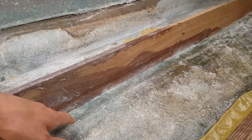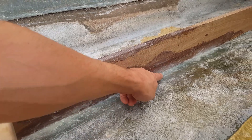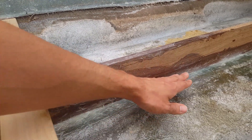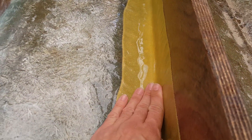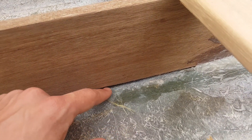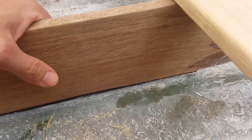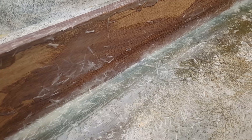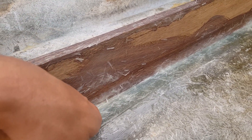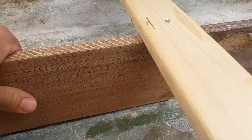I've gotten a few questions about how to apply the peanut butter properly. What you want to look for is any kind of gaps. You'll see how I've applied it to make a smooth edge, and it just gives something for the Kevlar to stick to. Do you need to have peanut butter applied under the stringer? Not necessarily. But as you're applying the peanut butter paste in between these stringers — you'll see here we've got about a quarter-inch gap — the peanut butter will kind of flow in there. The epoxy or polyester resin, whatever you're using, will actually flow in between there naturally as gravity pulls it down. It also depends on how thick you make your peanut butter; if it's really super clumpy, it probably won't flow, but if you mix it well it'll flow into those cracks and create the bond you're looking for.